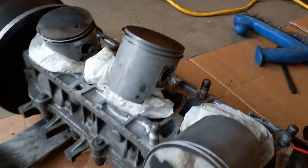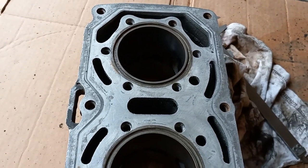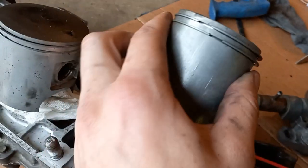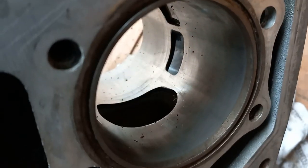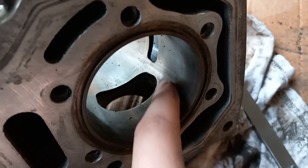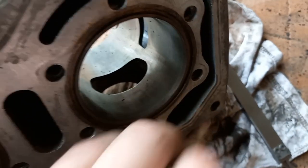Now that we've got the ring set, I measured the ring gap on each one of these cylinders and found the gap that was tightest on all of them. They varied by one or two thousandths depending on the cylinder. Now that we've got the rings measured, we just installed them on the pistons. The next thing to do is crosshatch the cylinders. What this is — you can kind of see how there's none left in here — basically at a forty-five degree angle, it's just tiny scratches inside the cylinder wall that hold oil better. It basically impregnates oil into the wall.